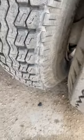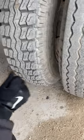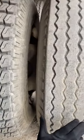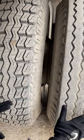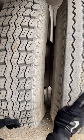Then I'm going to come out and talk about the sidewalls of my tires. The sidewalls of my tires — I'm going to make sure that they have no abrasions, bulges, cuts, properly mounted and secured, no audible leaks. The tops of my tires — now these could be recapped, but I want to make sure that they have no abrasions, bulges, cuts, properly mounted and secured, worn evenly with a minimum of 2/32nds of an inch of tread depth, no audible leaks.